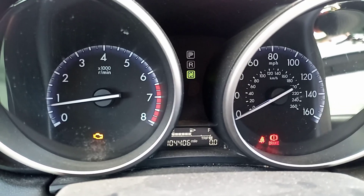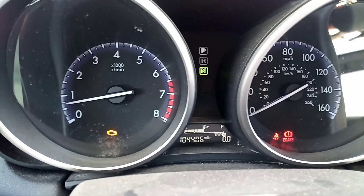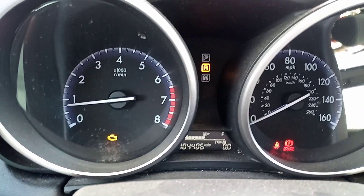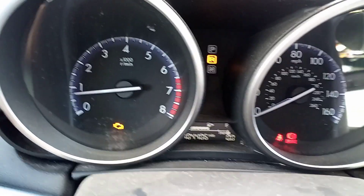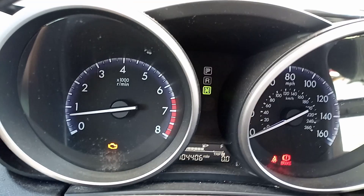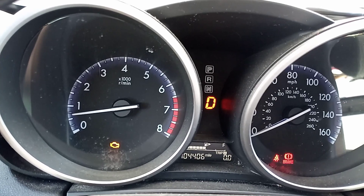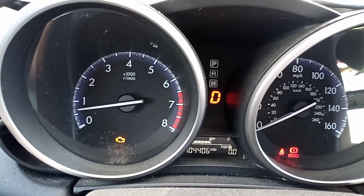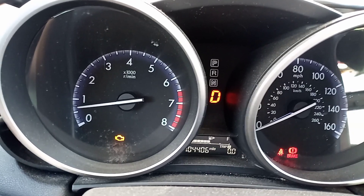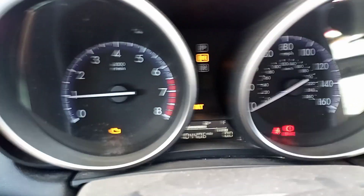The car sounds normal right now, but just wait a minute and you'll hear a fan going. Then you'll see the gear letters are not gonna work — they may come on or off. Once that AT light comes on, your shifting is not gonna be smooth or it's just not gonna be there. I'm gonna be poking a little bit in the engine bay and check all the grounds first on the TCM or the computer module, just to make sure we get good grounds.